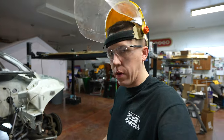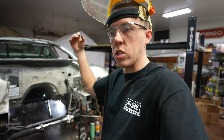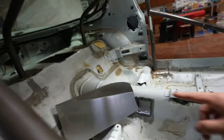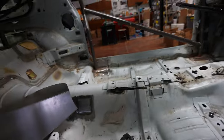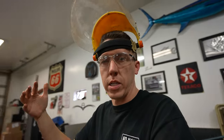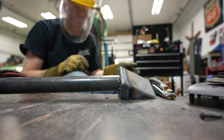Once we get this one fully welded we can reinstall them, weld up portions of it, and as long as it's solid enough we'll start adding bars to the rest of the cage. Inside the car I want to clean up — add in the tunnel opening area, cut out all that bracing over there, cut out all this bracing right here, cut out the seat mounts, and try to ditch some of this weight. We might even go crazy and cut some of the lower roof structure out to lose weight on the roof, now that the car is getting a full cage — we can lose some of that rigidity of the factory structure.